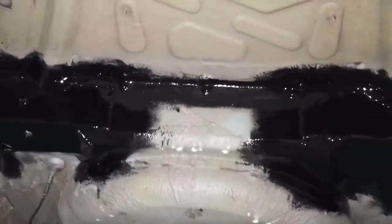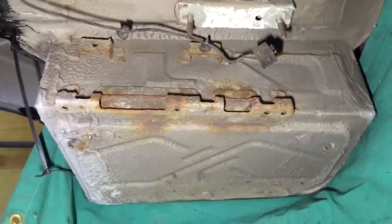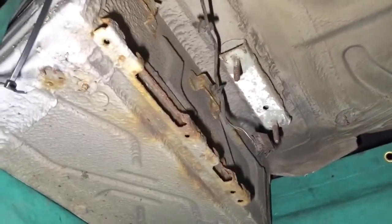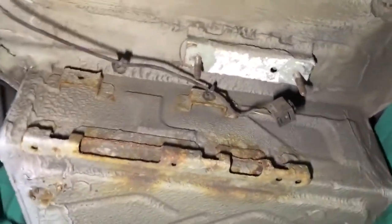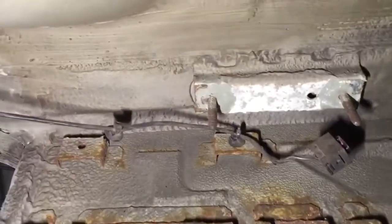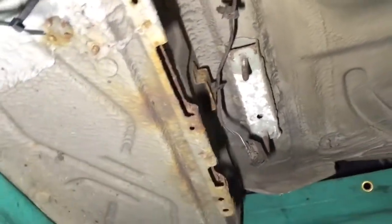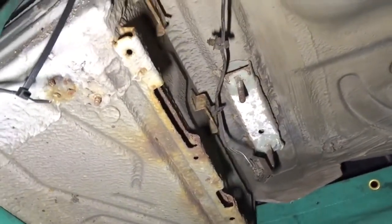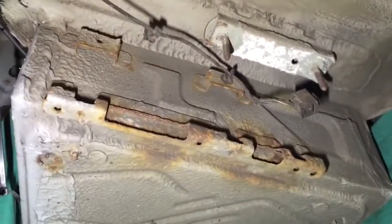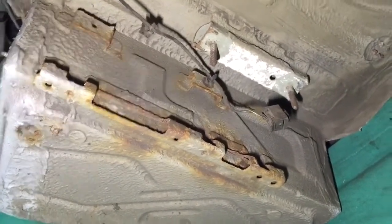You asked what the rest of the car was like, so I thought it would be easier to do a picture. This is the battery box, or the battery tray, on the right rear of the vehicle. That's quite common on all M3s. They don't use this bracket. It's totally redundant on an M3. It's for 316 and 330 carbon canisters to clip to, and there's two other ones above it. They're quite poor. Still quite structural at the moment. It's nothing terrible, it's not holed or anything, but that's something that we would recommend probably cutting off, like we do with our underside restoration processes. Get rid of that, treat the corrosion behind on the battery box, POR 15 that, and reseal that.